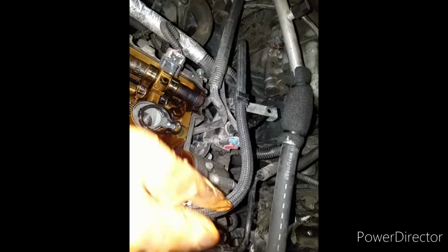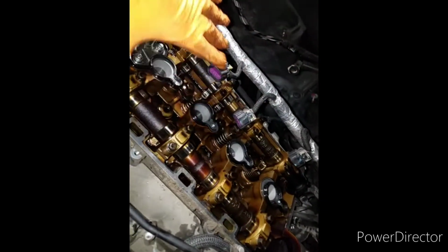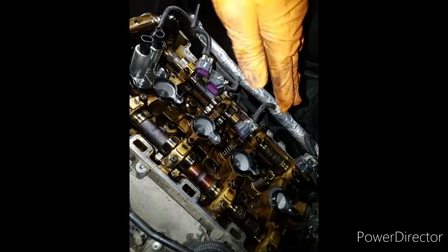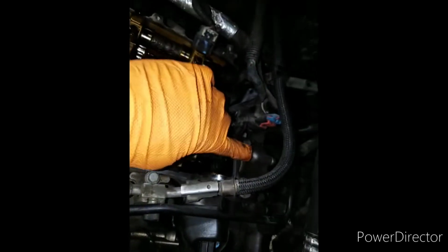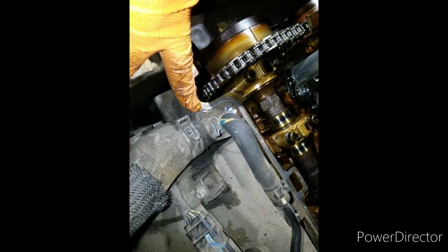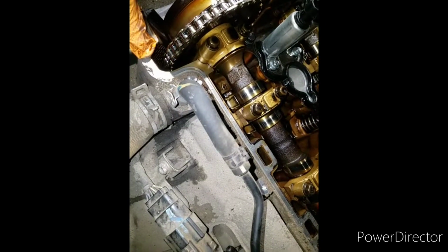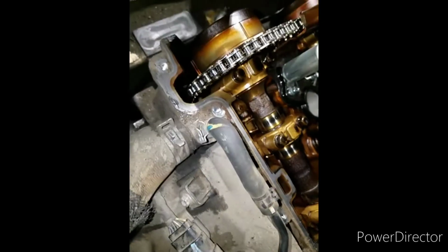You could just squeeze past this. You know, you take these screws out, all the bolts out of the valve cover. Lift up like this and then come like this and it'll come out right here in this area. But other than that, the valve cover wasn't too bad. It was really hard for it to pop up though. It was stuck. I mean, stuck on. It would not move. You know, I did scratch it a little bit in this little area trying to get it off, but it'll be okay right here. This is not sealing in that little spot where I got it at.